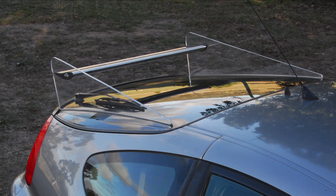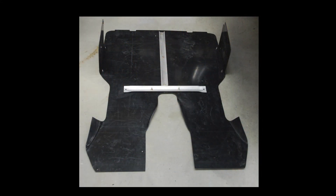This gives you enormous power to tune the aerodynamic performance of your car. Let's imagine you're putting a wing on the back — at what angle of attack should you have that wing? If you've read that 15 degrees angle of attack is correct, 15 degrees compared with what? Compared with true horizontal, or with the angle at which air is approaching the wing? On real cars — for example a sedan — the air approaching the wing is not parallel to the ground; it's actually coming down at an angle that follows the rear bodywork. If you can measure the ride height at the back of the car, you can adjust the wing angle and do direct testing until you're getting the best downforce. The same applies if you're fitting an undertray — say a front undertray. Is it being effective in reducing lift? If you can measure ride height accurately, you can tell to within a few millimeters whether you're getting downforce or lift and what the difference is with that particular undertray.